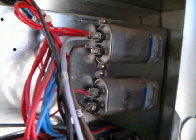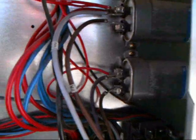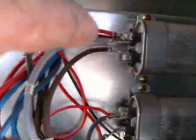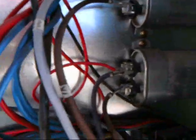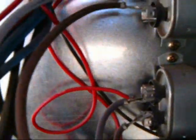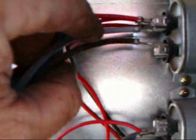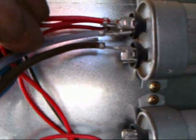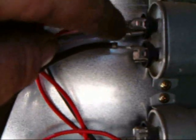Nothing. That is because the fan motors are tied to both run capacitors, and when you take the power away, the voltage that might be charged up on the capacitor is now discharged within a few seconds, because the fan motor windings are still between the two terminals.